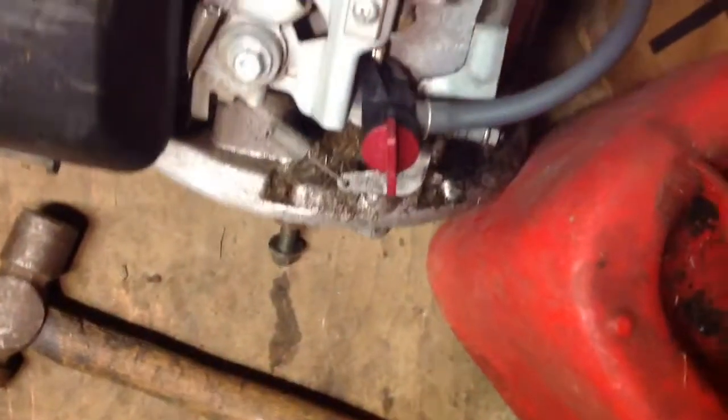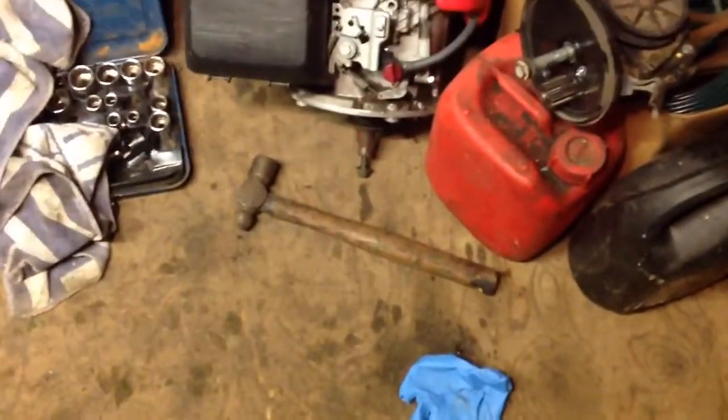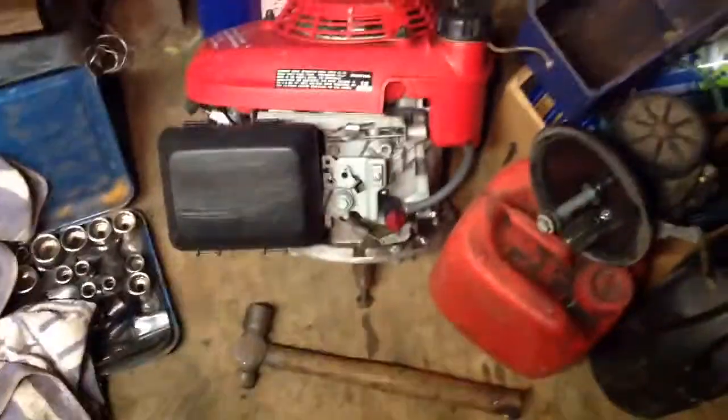I've just got to clean around the bottom of the engine a little bit. It's just got a little bit grubby around the bottom. To be honest, the engine's pretty clean, to be fair. It did run okay, but I am still tempted to take the bowl off the carburetor, just give that a clean to make sure there's no crud, and then check the tank's clean. And I'll drain it of oil before I put it on, so that he can have his new oil afterwards. Tipping it around means there won't be any oil in it. So I'll probably be onto the engine next. That won't take very long, half an hour job I suppose.